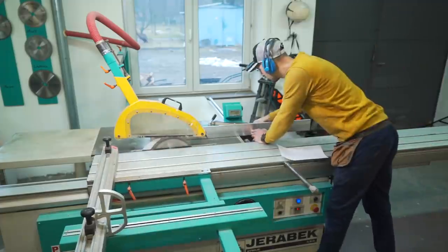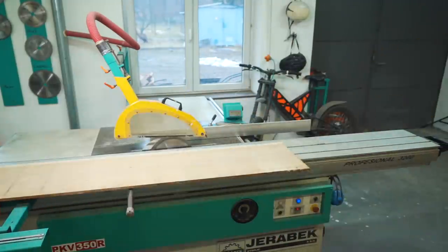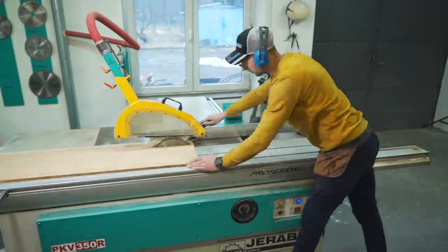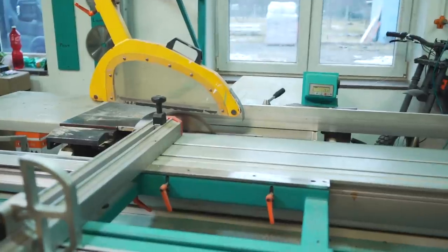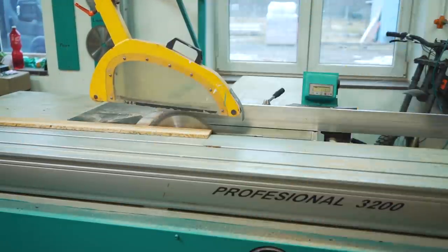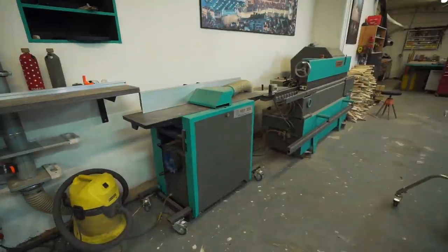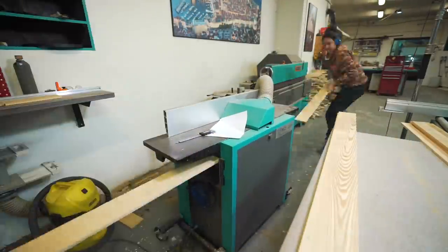Lottie is doing all of this to create 4 main attachments to frame the ceiling. The roof of our van is not completely flat, but has a bit of a curve to it. By making these custom attachments, we'll be able to utilize every centimeter of the ceiling space, and that will give us as much headroom as possible. This will also keep our attachment frame really tight against the body of the van.